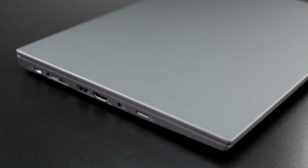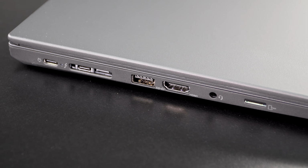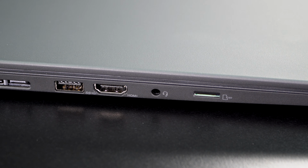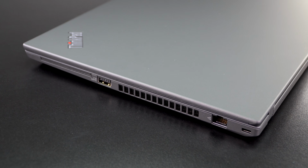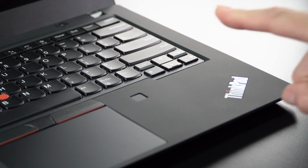Like a mobile workstation, it has a lot of ports, which is something you don't always expect to see, especially on an S-series, thinner, lighter laptop. We have 2 Thunderbolt 4 ports. We have 2 USB-A, one on each side. Conveniently enough, you have an HDMI 1.4 port. You have a micro SD card slot that's UHS 2. And Ethernet too, gigabit Ethernet, and of course the headphone jack. So not bad in terms of connectivity. You're certainly not resigned to dongle life here or desperately needing a docking station, though of course Lenovo does offer docks for all their laptops. Oh, and of course there's an optional smart card reader because it is a business laptop. In terms of security, you have a fingerprint scanner and a Windows Hello IR camera is optional on this.